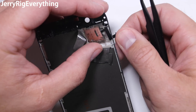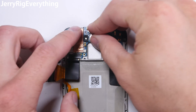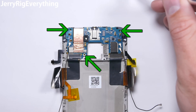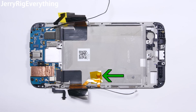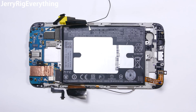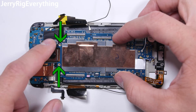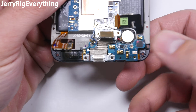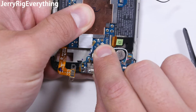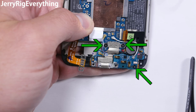The guts of this phone are messy, but at least they are modular. Let's put this bad boy back together. The straighter the ribbons are from the top board, the easier they will be to plug in later — so line those up with the lines underneath the battery. Get those three screws back into place and always keep your screws organized, even if they look the same. Make sure to lift up the power and volume buttons before you put the battery down. The camera from the middle board will tuck underneath the top board, then get the two screws into place. Feed the capacitive buttons through the mid-frame from that charging port, make sure they stick, then set the charging port in place. Plug it in along with the two wire connections on either side and the three screws.